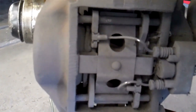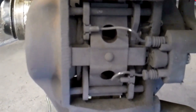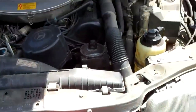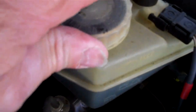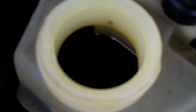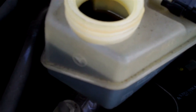The brake light will come on in a short period of time. If it hasn't come on already it will soon. I just want to let you know the brake pads are almost finished. Okay Stanley, the next thing we're going to show you is the brake fluid. The brake fluid in the brake fluid reservoir is very dirty and it needs to be replaced. Typically brake fluid is an amber transparent yellow color and your brake fluid is a very dark brown. I recommend that you go ahead and have the brake fluid system flushed.